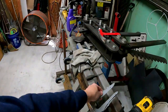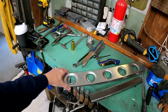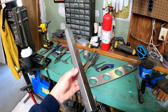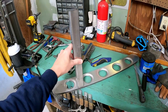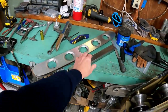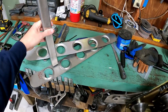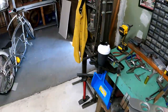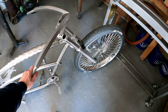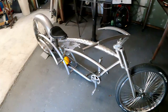For the front, I'm not super worried — the front just needs to not flap side to side, so I just need to keep it in place. I made this a while back, so I think this could be a side piece. I'll cut a couple of these out here which will go on the inside of each one, and then I'll rivnut them to the actual post on each side since this is aluminum. I'll make a cap on the end there, rivnut it like that, and then it'll actually hold the wheel in place where it can't flop around — because the last thing you want is your handlebar swinging around and smacking your paint.